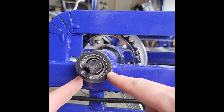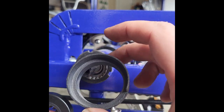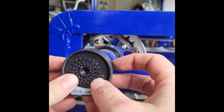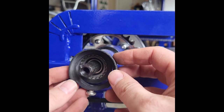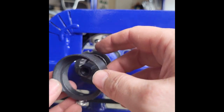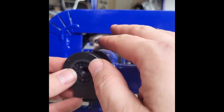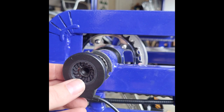If you have this kind of extra rim right here, the pedal sensor guard will not fit properly. This was really just made to help protect the pedal sensor just a little bit. It would essentially go like that and fit right onto the bike. However, with this extra little metal rim here on the newer bikes, the sensor guard will not fit over that. So if you do have this piece, the sensor guard is not necessary. This will protect your pedal sensor and give it enough edge so that this isn't sticking up over the edge of the frame of the bike here.